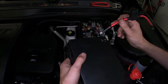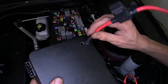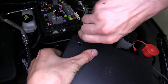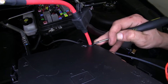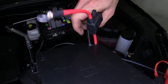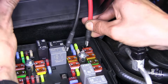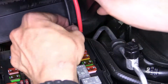We'll take our red wire — the one that has the fuse holder in it — and this will go on the side closest to the driver's side since that's the hot side of our fuse. We'll push that through the hole we made in our fuse box, then push the grommet inside the hole, using a flathead screwdriver if needed. We'll repeat the same process on the other side with our black wire. With our wires pulled through, we'll take the red side with the fuse holder and attach it to the terminal that had power, and the black one to the other terminal.